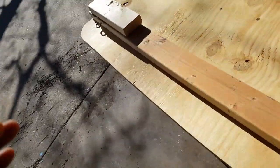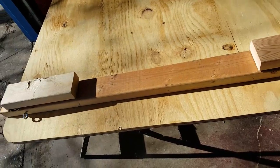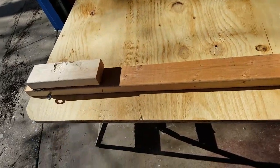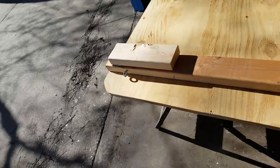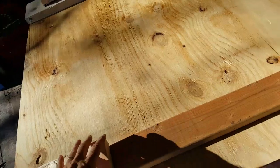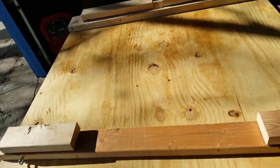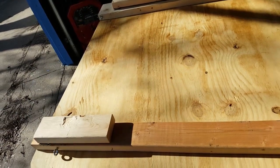I tried it without bracing — my wife and I together are around 320 pounds — and the three-quarter-inch plywood would sag and bow in the middle. It would bow down into any storage we put underneath it. So I've added some two-by-four cross members, 48 inches long, cross-bracing the whole board from side to side.